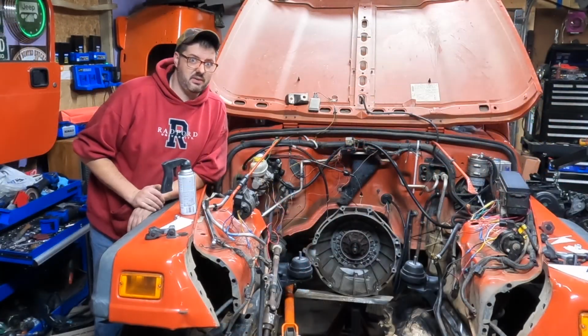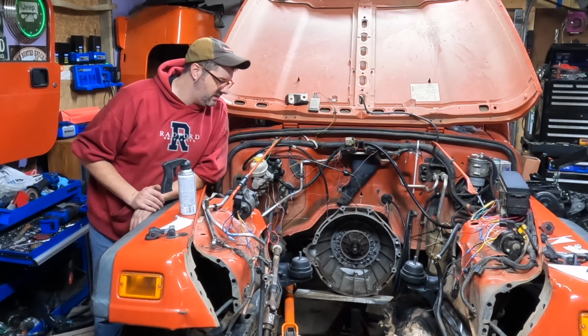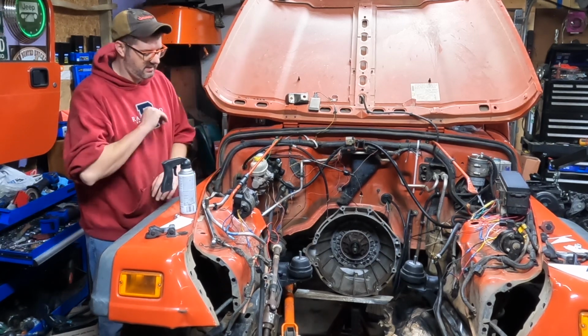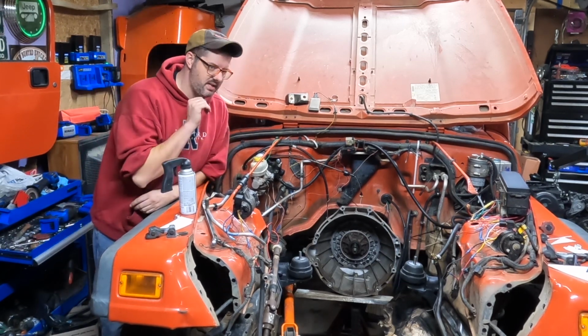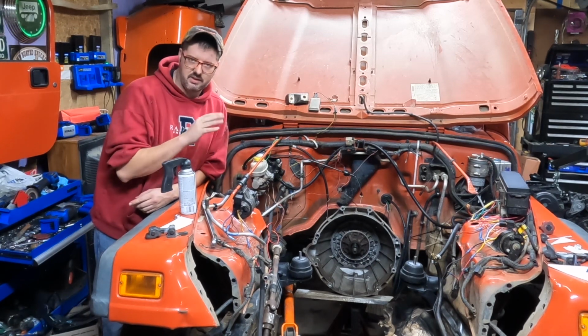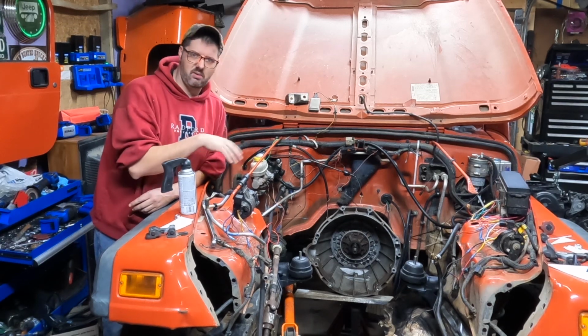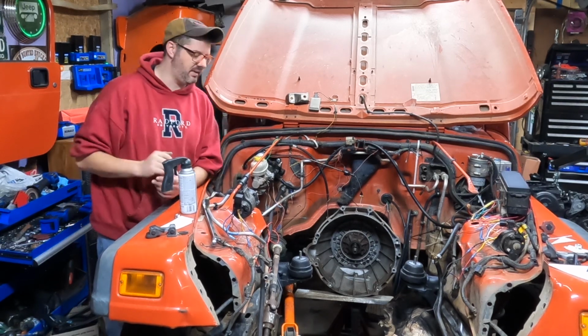So I have been welding for probably the past 2.5 to 3 hours, gusseting everything, and I have the motor mount plates that bolt to the BEW TDI all welded up. I'm really happy with the gussets. They're outside drying right now. I went ahead and painted them so they wouldn't be bare metal.